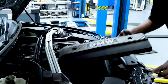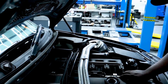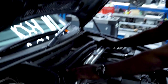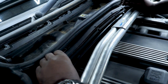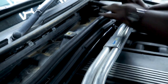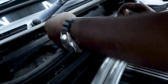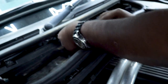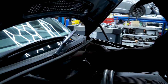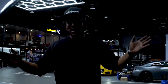After all six spark plugs are done, close the oil cap, put the first valve cover plate back in — it goes in underneath the second — then the second plate goes on. The cabin filter housing goes back into place, run the two wires back through the plastic casing, lock it up, and tighten the 10mm bolts. All done!